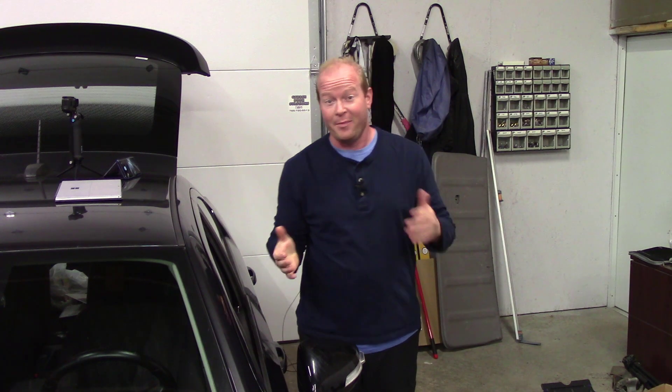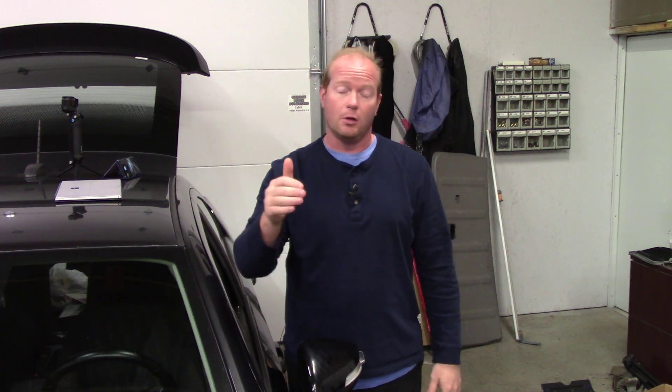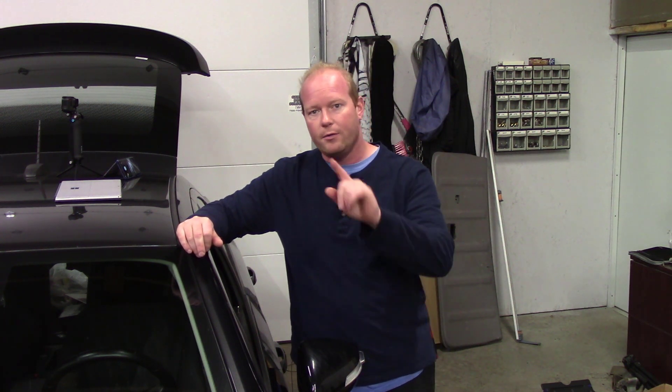It's alive! It has been a long time coming to get this car running — going from two wrecked cars into one, programming modules, replacing modules, replacing airbags. It has been quite the journey. I hope that you learned something with this J2534 video that is not nearly as scary as everybody makes it out to be. Make sure that you have the proper tools to do it. Don't just hook another battery to the other battery and see if it'll work. Make sure you have a stable power supply, a good J2534 device, and a good PC and internet connection. This is not exclusive to Autel — this is the same process with any J2534 device. Just follow the directions, go step by step, take your time, and make sure you're doing everything per the OE manufacturer.